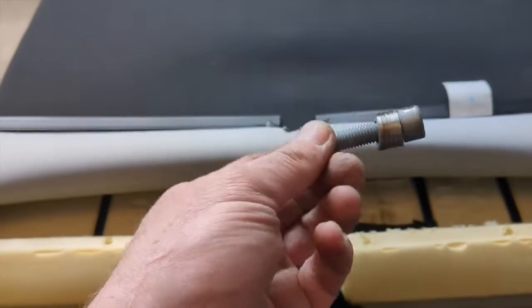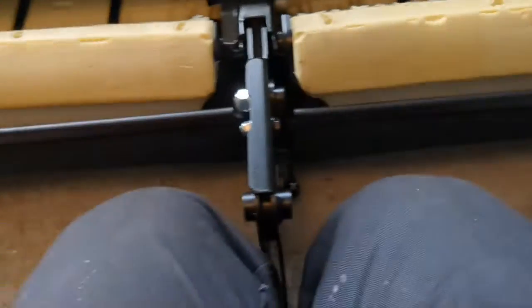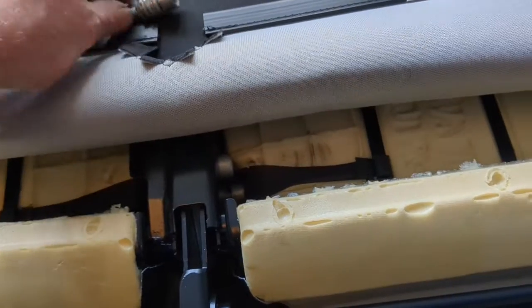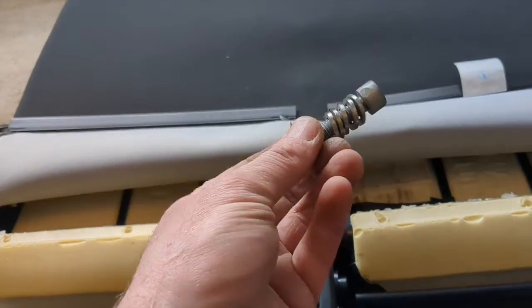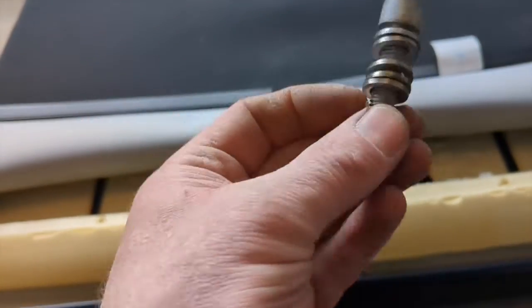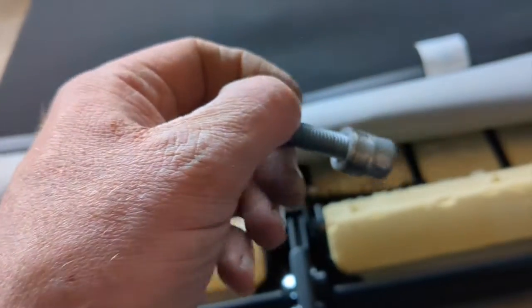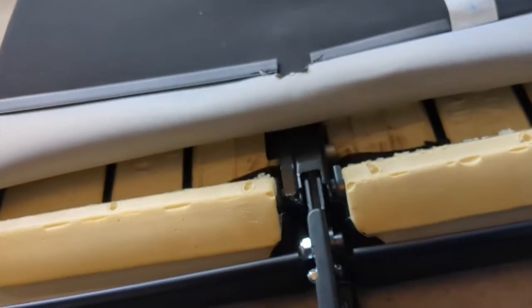What I've fitted it all up together once, and I've noticed that this bolt, which goes in this position up here, seems to go through really quite a long way with a lot of thread sticking out. So rather than cutting the bolt down, I've decided to get a load of washers and got a grinder on them, grinding wheel, and just sort of taking them down. So hopefully they will now fit, and they'll just space the bolt out a little bit.